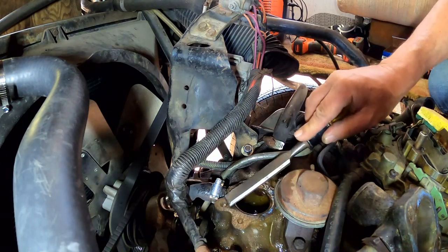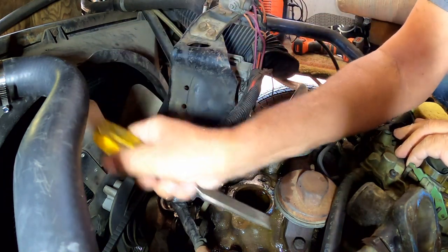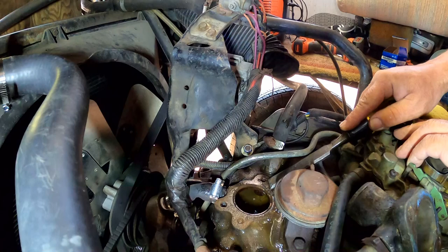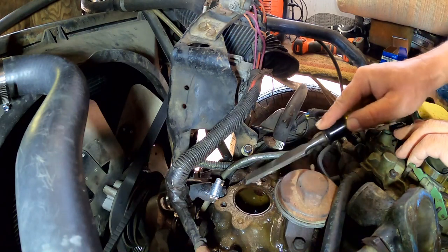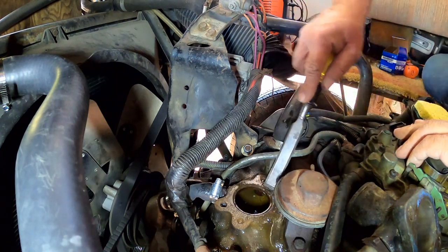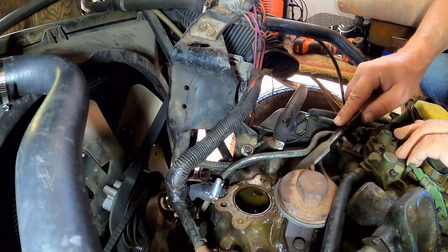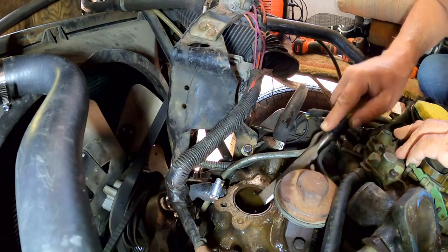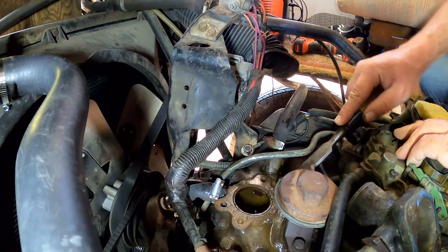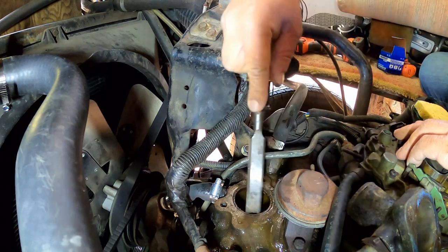I've gone over here initially with a gasket scraper, or razor blade scrapers also work pretty good, depends. And go over it with some cleaner and some Scotch-Brite and wipe it off and examine it really good. And then it seems like there's always that place that you just didn't see. And you say, if I missed that, then maybe I missed some over here too. When you put this much work, and oftentimes money in parts, it really stinks if you miss something and you end up with a leak.